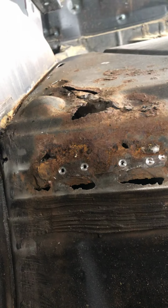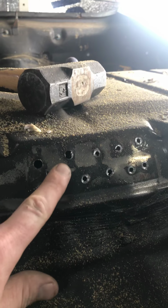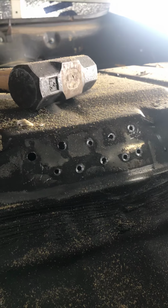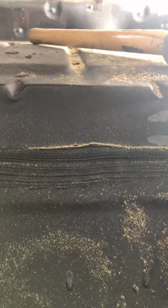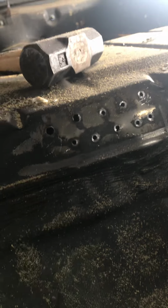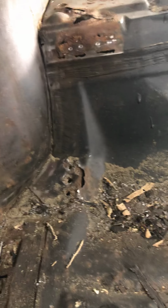All of the old school body guys that I know, here's a better look too. I went through a few of them, but most of them I was able to just get off just the one panel. And it makes it a lot easier to weld everything shut. You can fill these holes. If that happens, even if you booger it up a little bit, you can always grind it down. I weld for a living, but I still have my days where some of my welds don't look the best, that's for sure.